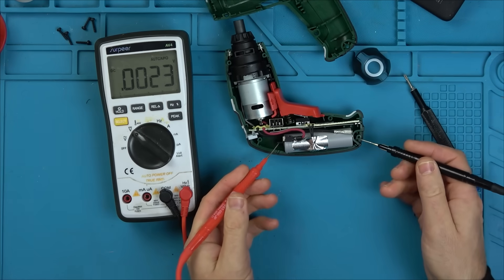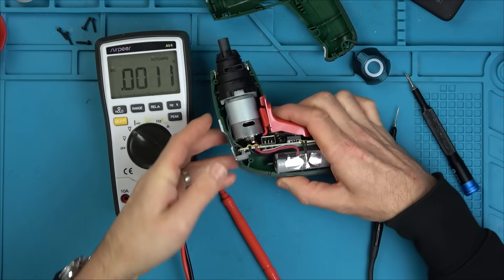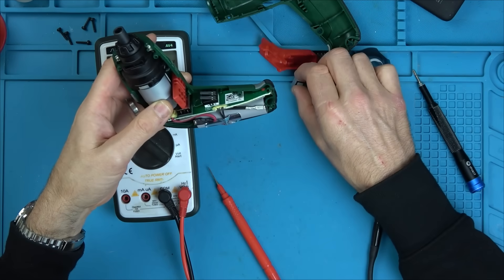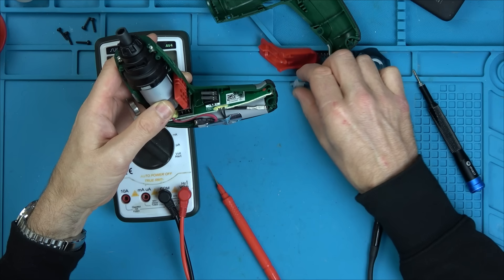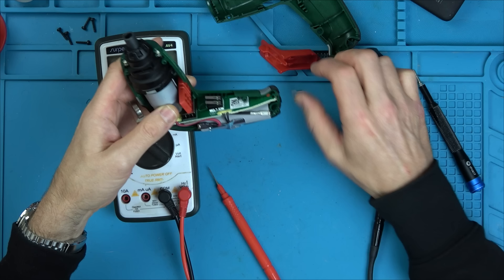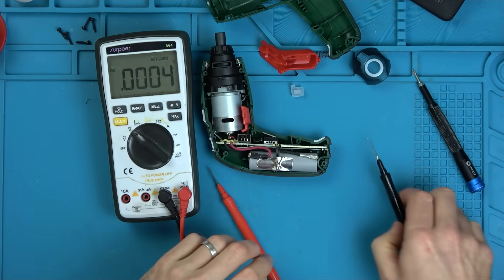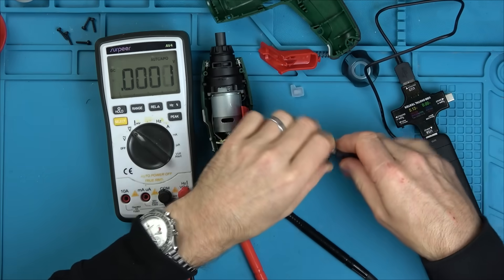Nothing at all. How bizarre. So I wonder, has the battery itself failed or has something on the board caused that? We've got two micro switches here — this doesn't have different speeds, no speed control, no slow and fast. So what are the two micro switches for? I'm thinking it's in case one goes faulty, because the switch is always going to be the weak spot. Then the user won't actually know that one's faulty because the other one will still be working. If that's the case, that is a lovely little bit of design. Put it down in the comment section why you think there's two micro switches — I think it's so if one fails, the user will have no idea and that way Bosch retains its reputation.